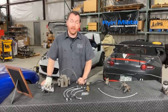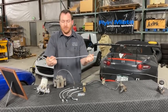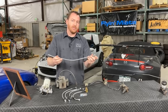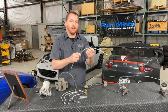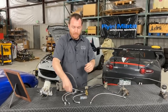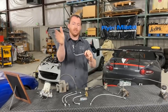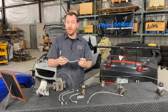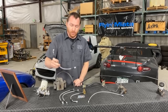How often do you need to replace or check your stainless steel brake or clutch lines? These are very stout and don't really wear out — at least not in most people's lifetimes. Usually what we see when people need to replace these is because they didn't route them properly, and now they're up against something that's rubbing and it'll rub a hole through the urethane and into the stainless steel braiding. Or if it's bad enough, like with a brake line actually — we've seen this happen — where they don't route it properly, and as the wheel is turning it contacts the brake line and rubs through it to the point of opening up the hydraulic system. That is generally the failure mode. Otherwise, as long as you route them properly and keep them clean, they'll probably outlive your car, possibly even you.